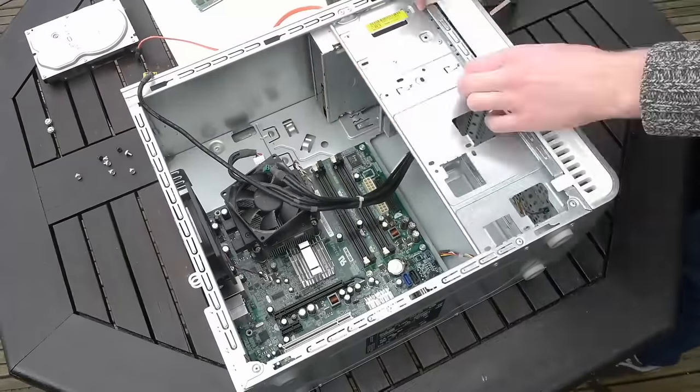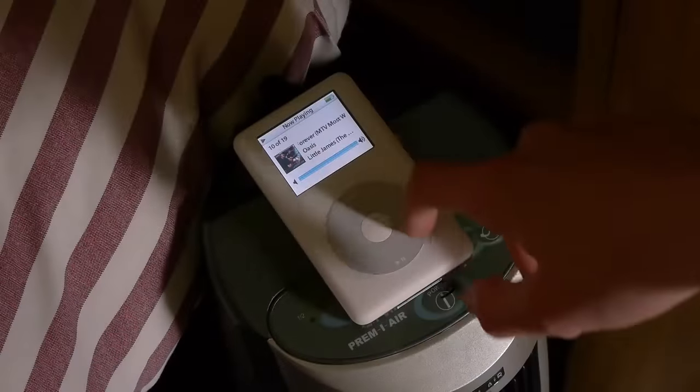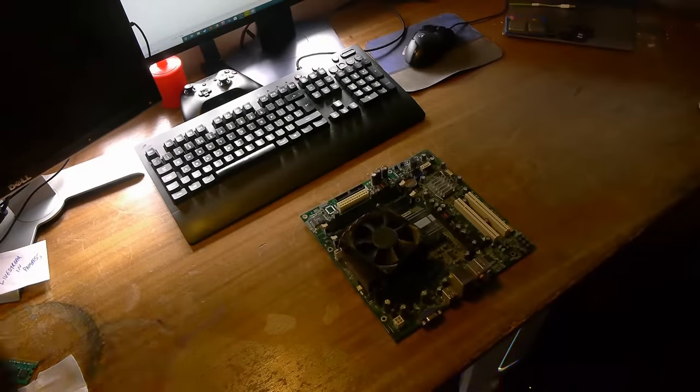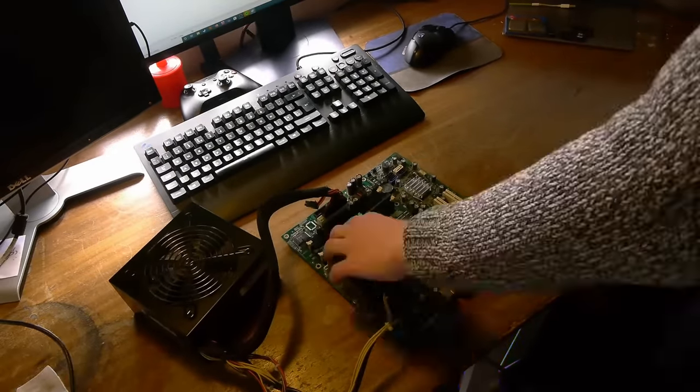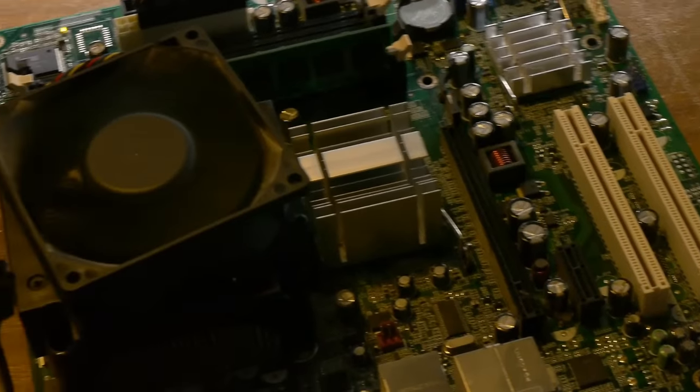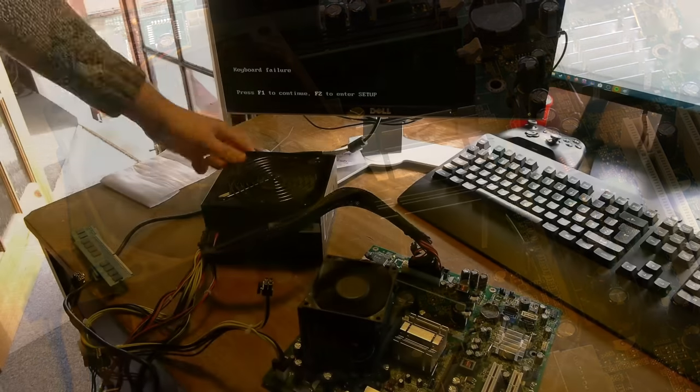Really though, the only way to test for this is to rip everything out of the system, turn up the tunes, and diagnose all the parts, as there must be something going on here that's stopping our system from turning on properly. This is where things get a little bit strange though, as after reseating the CPU and sticking in 4 fresh sticks of RAM, it seemed to post absolutely fine, albeit the CPU didn't seem all too happy, and did hang a few times, which I figured might be damage from a voltage spike from that old power supply, but CPUs are generally pretty hardy, I don't often see them die.